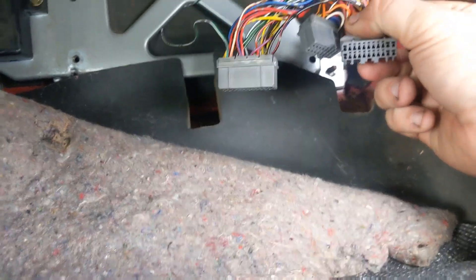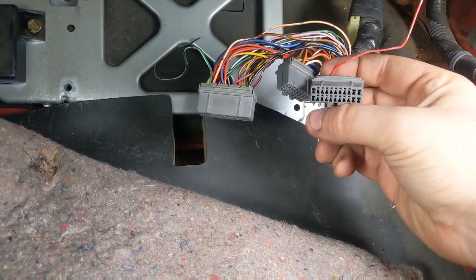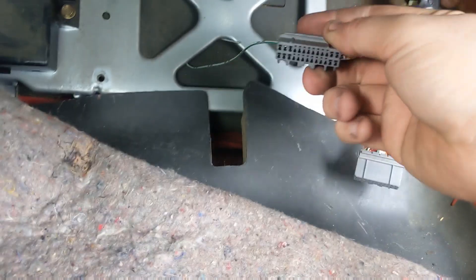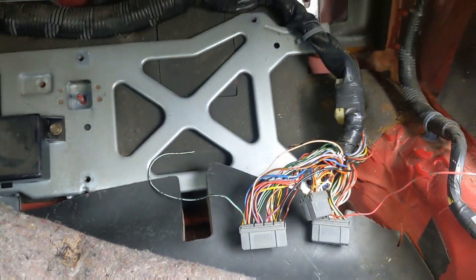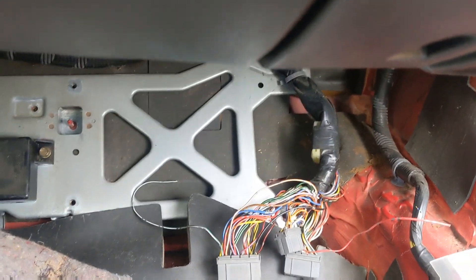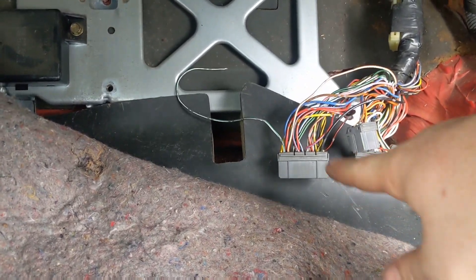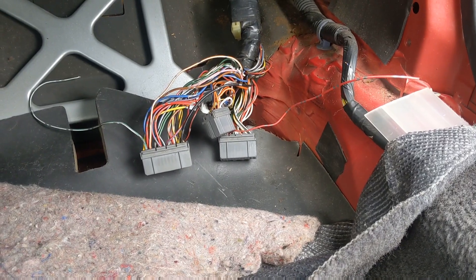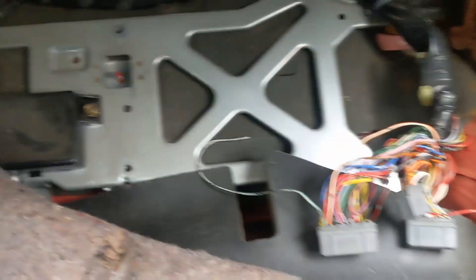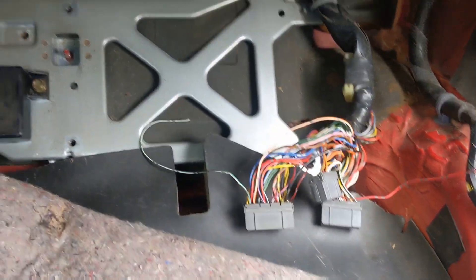You can see how the ones on the ends are bigger — you'll get one of the ones from the middle. I had a few old ones that I used just for this, so it worked out perfect. Now, like I said, we're just going to splice into this one. I'm going to cut these back, extend the wires, run them through into the engine bay, hook them up, and see if we got VTEC.